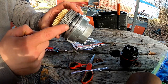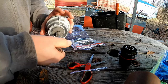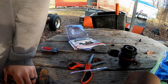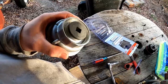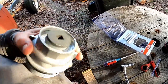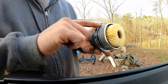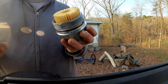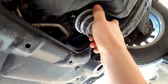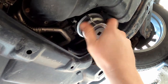You see it does already have an O-ring here, and it should already have an O-ring underneath this plug. Just like with your classic spin-on type filter, make sure to get a little bit of oil on the O-ring — keeps it from seizing in there and makes it easier to remove next time. And back into the car — let's feed it up in here and thread her in. It feels like it's threading in just fine, just like the old one.